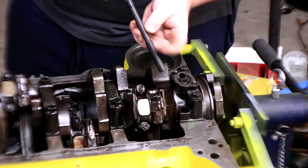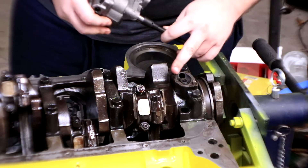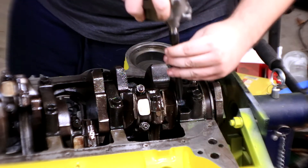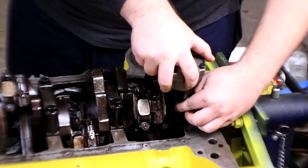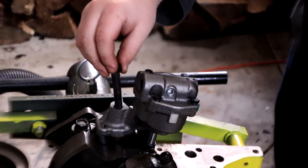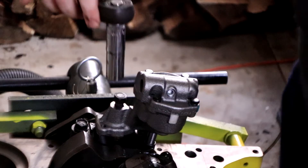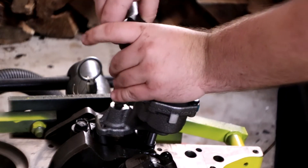Now all we're going to do is take the oil pump with the driveshaft. No RTV, no sealant, nothing like that right here — you want this surface dry and you want this surface dry. So you're just going to drop it down in there all together. It's going to link down on those pins. Then I'm just reusing the bolt from the old oil pump. Get it finger-threaded, and then this one's just a 5/8 socket that I'm going to tighten down. And then we're going to set our torque wrench to 65 foot-pounds.